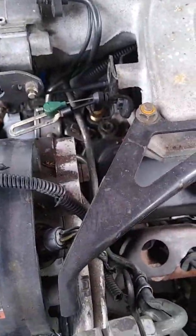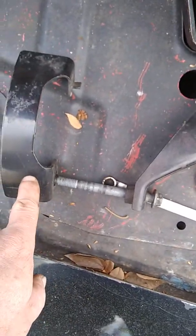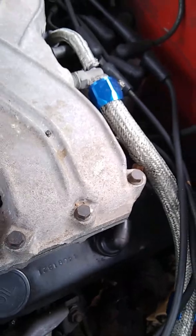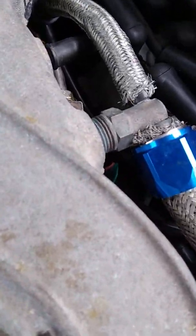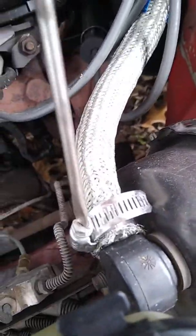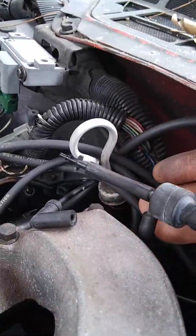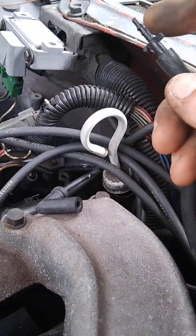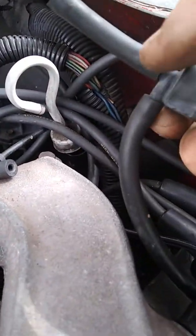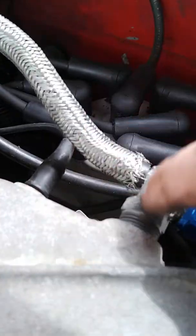The bracket will completely remove out of your way. This bolt screws in here and goes in front of your AC. As far as the hose back here, you will not have to remove this. All you have to do is remove the hose from your brake booster. Then find this vacuum line right here — remove it carefully, don't break this end — and also remove this lower hose. Everything else here stays attached so you don't have to remove it.